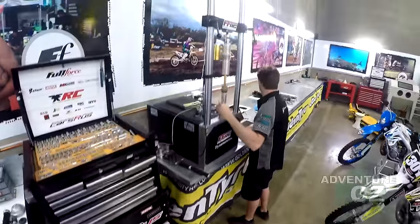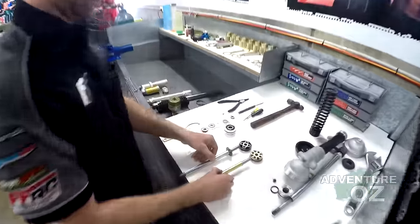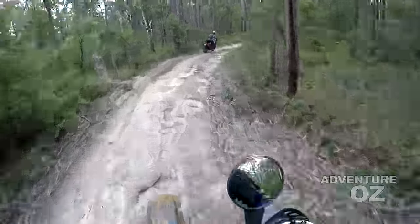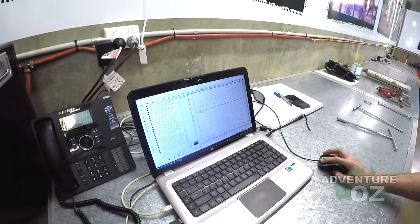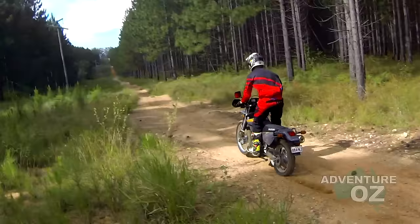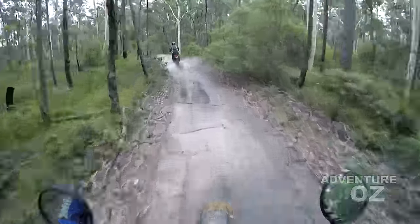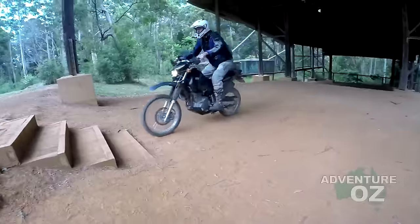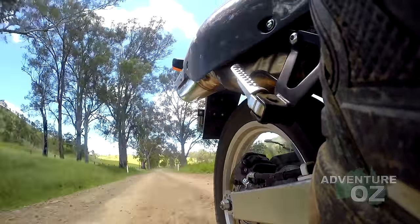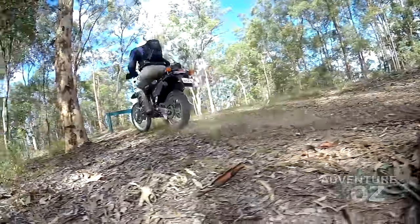On the rear, James felt the rear shock's damping was so poorly designed he didn't bother with the budget upgrade of replacing the stock 5-weight shock oil with 10-weight. The dyno indicated the compression and rebound damping are simply too poorly matched to get reasonable performance, so he custom made a new valve. Results? Brilliant. The rear end now behaves itself on fast choppy surfaces, but also soaks up those big hits from jumps and the like.